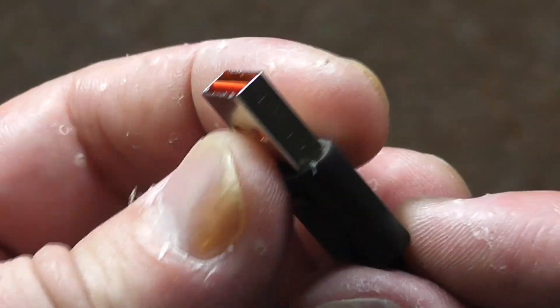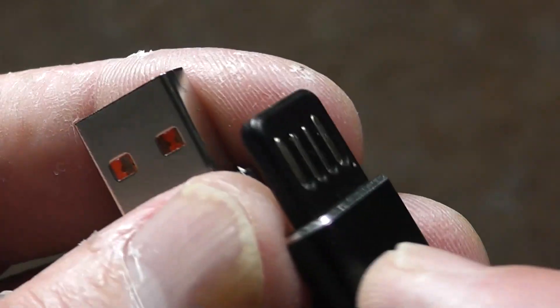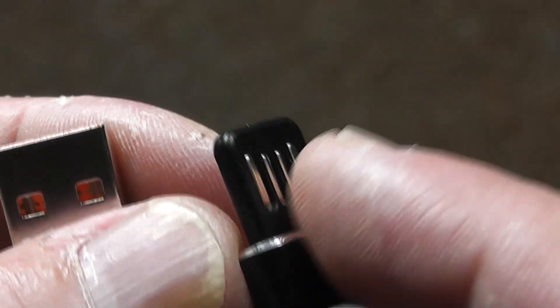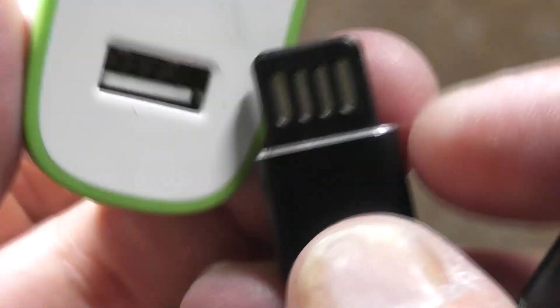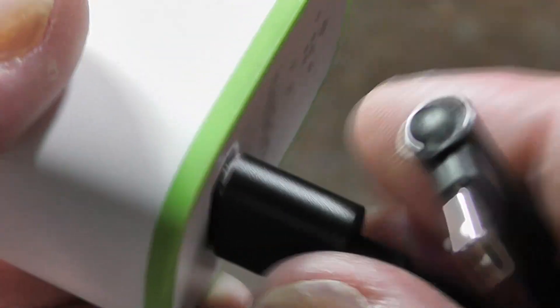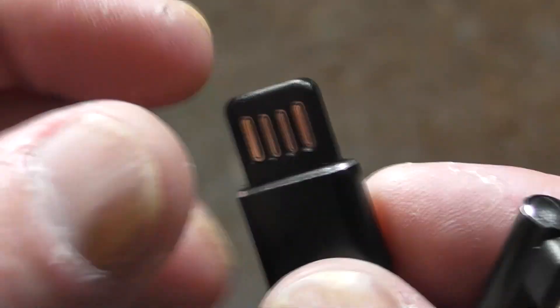But I do like that it's protected and robust. This style here seems to work just fine. It is also pretty robust, but in certain chargers and under certain situations, you kind of risk those contacts once again touching those little retention springs. It just depends on the specific design of the USB port and whether you make sure it's fully inserted. I think they probably should have made this connector just a little bit extra long, because as you can see it sits totally flush — and maybe made it just a little thicker so it holds tight.